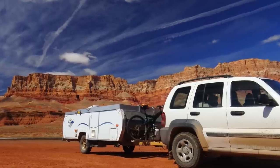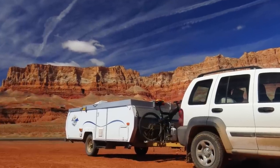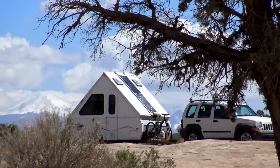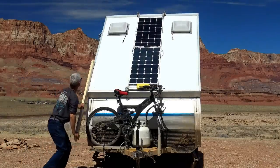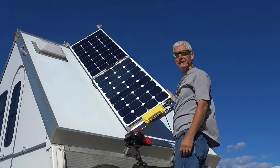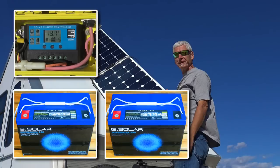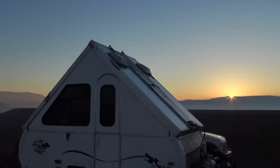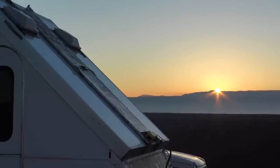A-liners and other A-frame campers have a big advantage over their larger cousins due to their compact design. The slope of the roof is perfect for North American Sun, but the trade-off is that the fold-up roof will only hold so much extra weight before it is hard to lift. That's the reason I chose lightweight flexible panels and not the heavier glass panels for the roof of my A-liner. I also added a frame-mounted controller and two deep cycle batteries for power storage. The only other ingredient to make this work was a little gift from mother nature called sunlight.